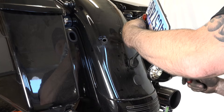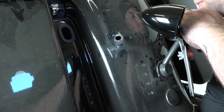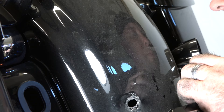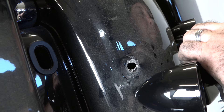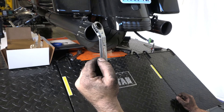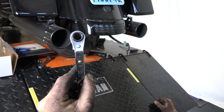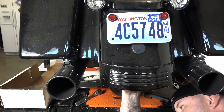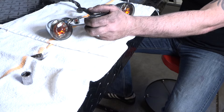This has your license plate light incorporated into it, your brake light, signals — all that. It is a Harley part. Chewy's getting the bolt started through, and we'll get this side started too, then evenly bolt them down from inside the fender. If you want to know what Chewy's using up underneath, he tried a lot of different tools — sockets and wrenches — but get yourself a set of ratchet wrenches. A half inch ratchet wrench is the key to success on this project. Then he gets that wire clamp bolted back down and plugs the connector in where we took the old one out.